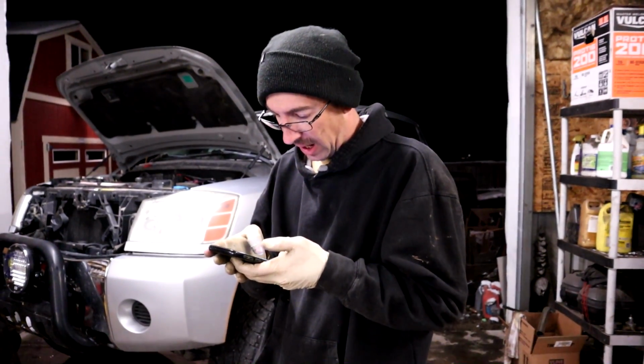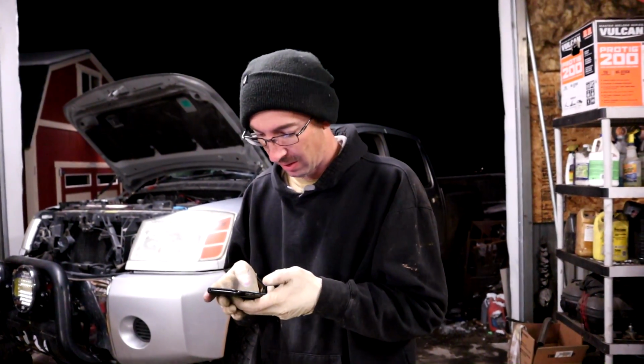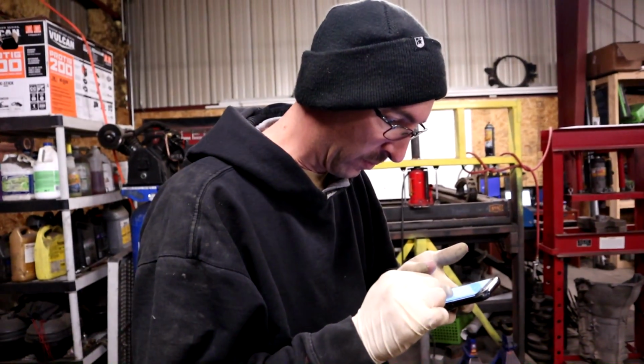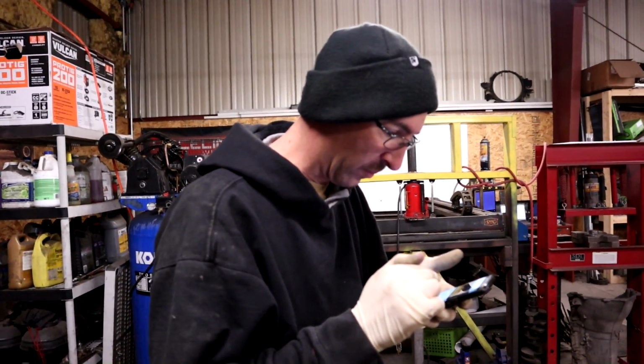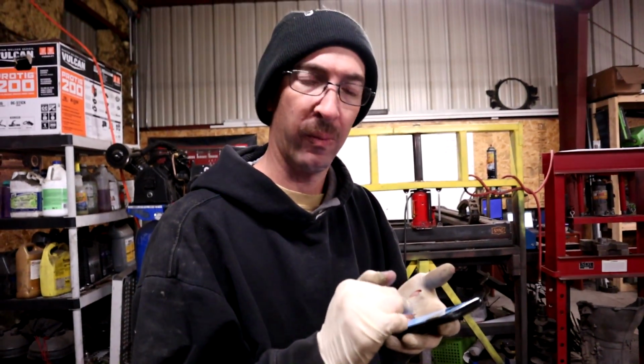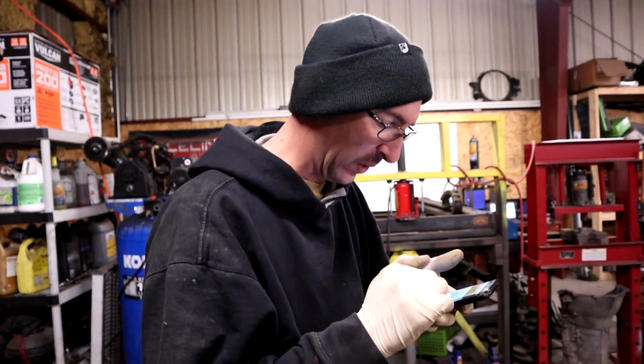So, what's going on? I don't have a clue. Can't figure out if we blew a fuse or cut the wrong wire, but I have a feeling it's a fuse or something random like that. What'd you do? So, it will not come out of park based on the brake switch. It will manually. And the heater doesn't work. Any climate control.